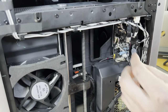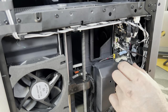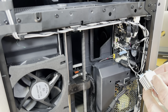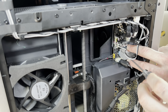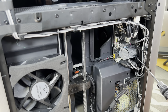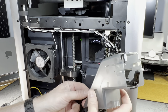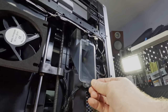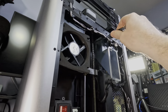At this point I decided I wasn't going to bother with the custom fan, because it just looked like it was too much hassle. Realistically the replacement fan should work fine and shouldn't require any more work. I've got the heat sink back on — obviously be careful about all that thermal paste, it can be a bit messy. Just check all the connectors are in tight. Now we can fit the chute back in place. I was missing a screw so I can only put two screws in to hold it, but there's also the screw that goes into the back case to keep it in place, so it's not going anywhere.